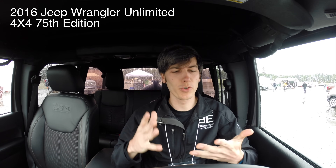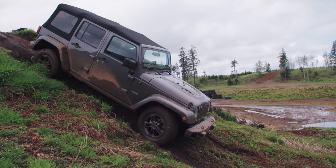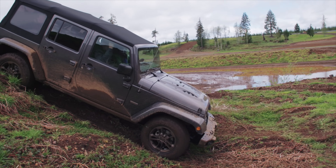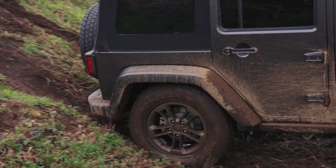The second thing is you should never put it in four-low while you're moving at speed with the transmission in gear. It should be in neutral and you should be at a stop. Some vehicles will allow you to do it up to two to three miles per hour, but the point is you should be going very slow with the transmission in neutral. Most vehicles will lock you out from doing this anyway, but it's worth understanding why.